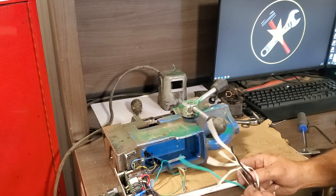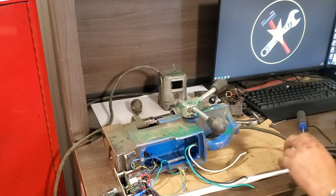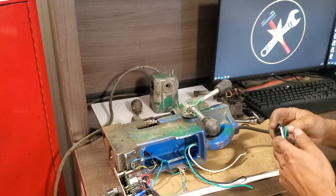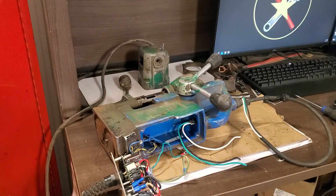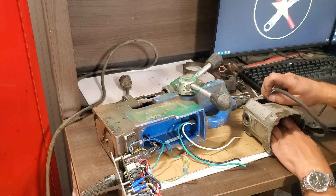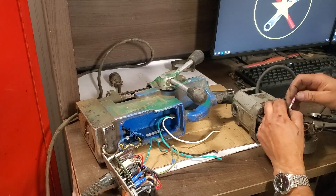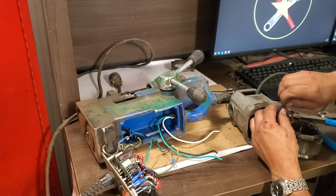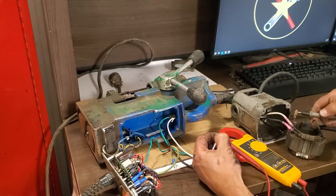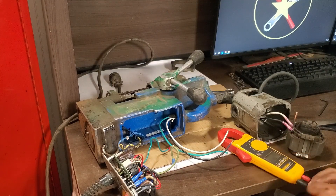I strip back a new piece of cord and insert it through the handle to the case and re-tighten the strain relief. I then need to pass the other end of the cord through the small hole and reconnect it to the stator by trimming and stripping the ends of the leads and splicing the wires using new insulated connectors. Finally I check the new connections by testing between each of the wires and the stator terminals.